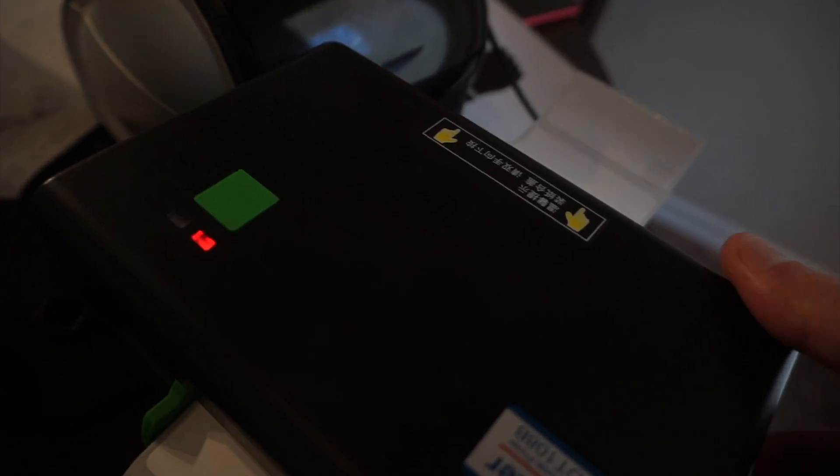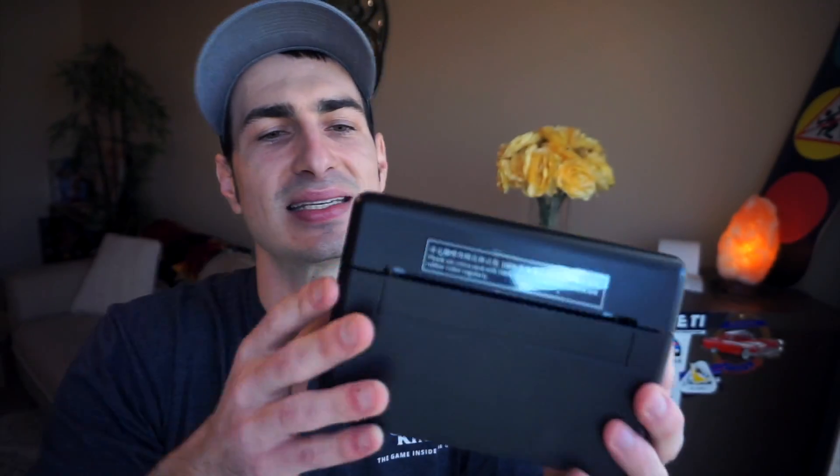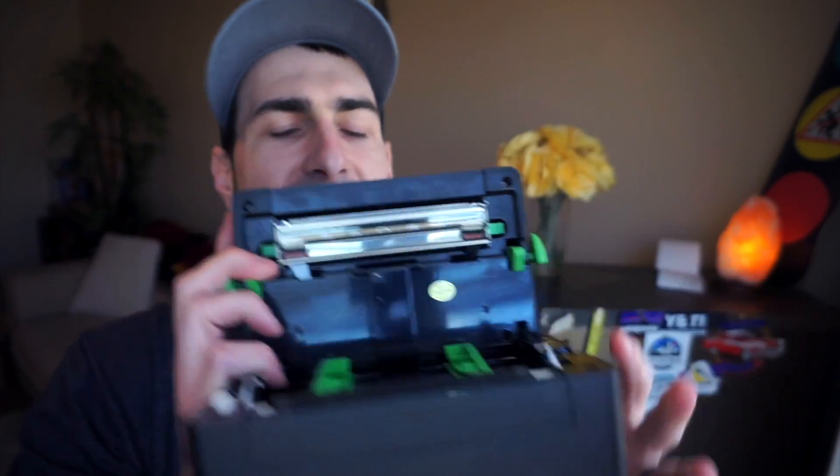The next thing I like is kind of weird — it's the way it beeps. It has this R2-D2 electronic beeping feel, and honestly this is the best-sounding printer I've had out of all the printers I own. The beeps might annoy you, but that's just a personal preference thing for me. Last but not least in the good category is the easy-to-clean design. The thermal print head is on the top and easy to access. You're supposed to clean these regularly — just use a swab with 50 to 91% isopropyl alcohol on the print head once a month and you'll be good to go.